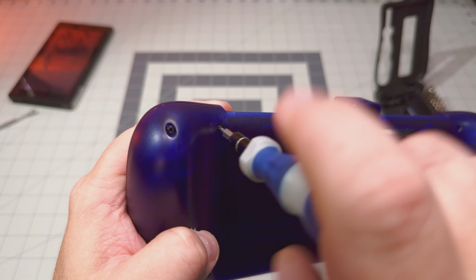You're going to come in and you're just going to pop that ribbon cable up there. And we also have the rumble power. So let's go ahead and pull the rumble power out. That's good. And we're going to disconnect the ribbon cable up here at the top. It's in here. It's a little hard to see. To do that, I'm just going to apply pressure on both sides here until we can pop that out. And there it goes. Slides right out. Pop those edges there. And just lift that out.